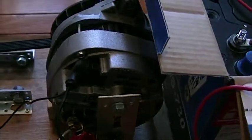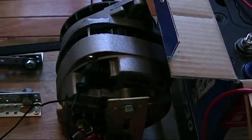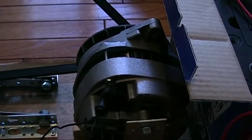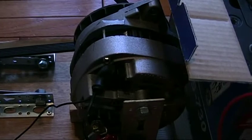The second thing is that the stator coil here is configured in a delta configuration rather than a wye star configuration. What this does is give higher output — higher amps at higher revolutions — but at lower RPMs it's a little less efficient.